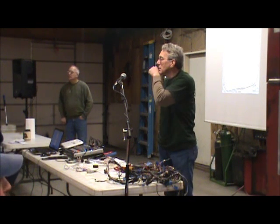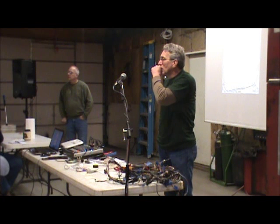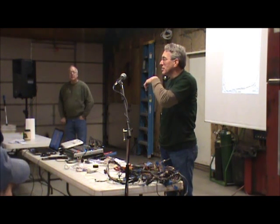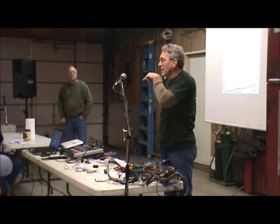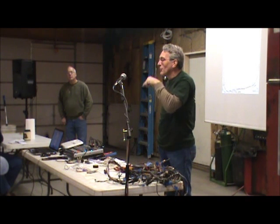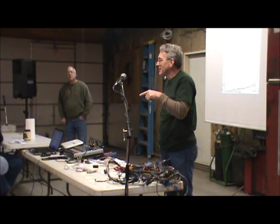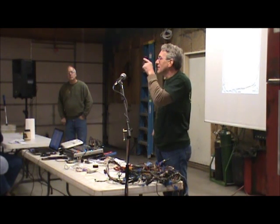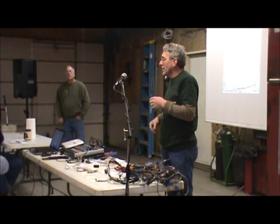So what about relays for the headlights? Yeah, because when you really think about it, the British never believed in relays. You put the full draw through every switch, which is why the switches melt after a while, especially as they get old. But yeah, if you can do a relay upgrade, absolutely.